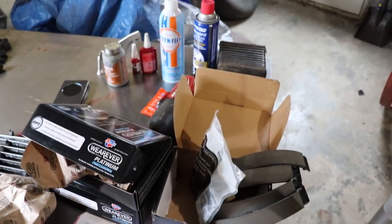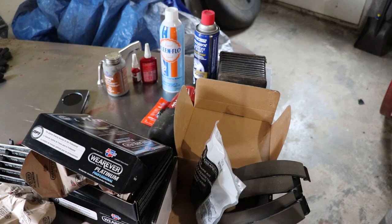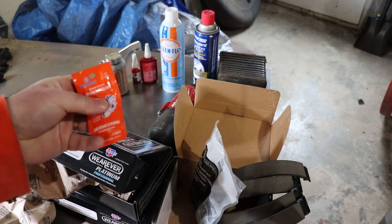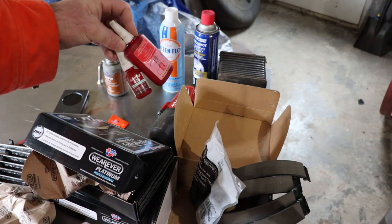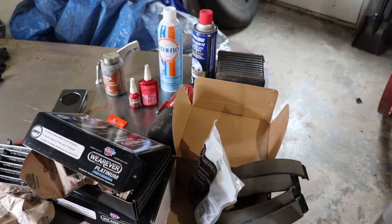Always get plenty of brake cleaner so you can clean the rotors off. Brake dust — whether it has asbestos or not — you're not supposed to breathe it. Hose everything off onto a piece of cardboard and throw it out; don't sweep it up off the floor. I always buy non-chlorinated brake cleaner so it's not as poisonous if you heat it up. I also bought some lubricant — turns out it came with the pads anyway. For Loctite, you can just get a small pouch of red Loctite rather than a whole bottle that goes bad.